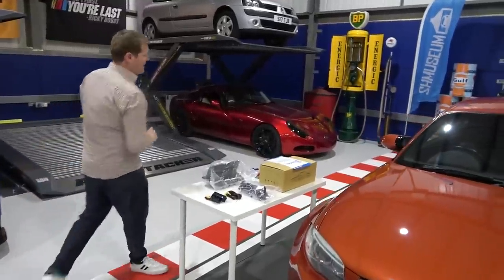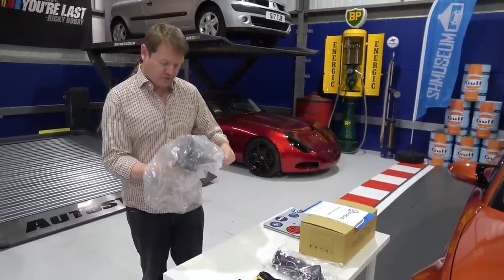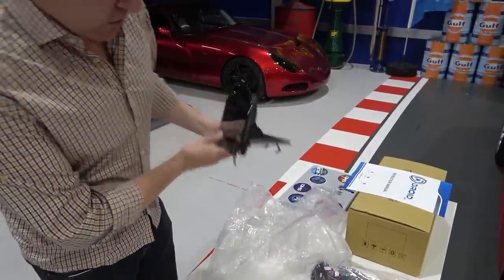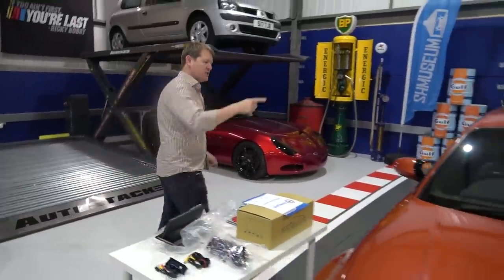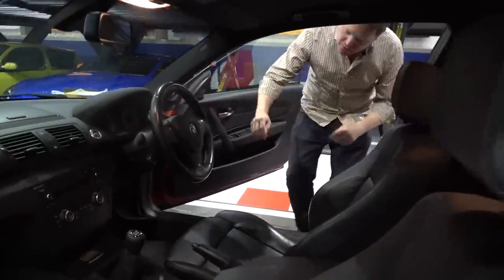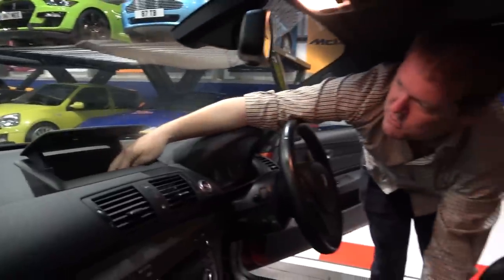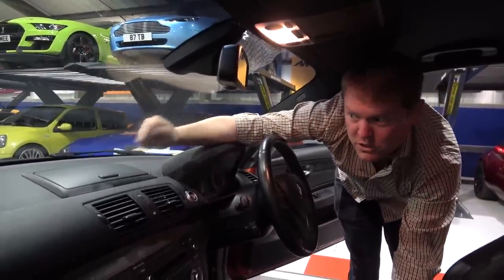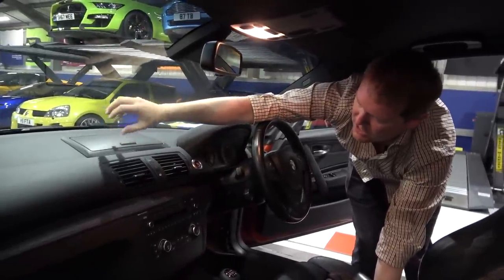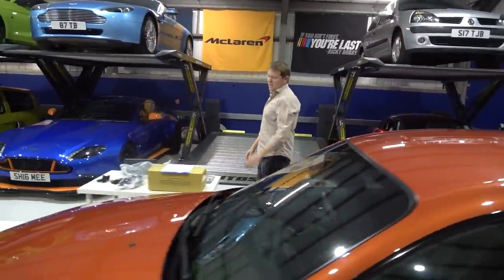But the first of those upgrades we're going to crack on with today — something I've mentioned a few times — which is to fit a new entertainment system with Android Auto and Apple CarPlay to replace the storage bin on the dashboard. So E80 Series, or E82 in the case of this 1 Series, could either have a completely flat dash, this storage bin, a small cubby, or the iDrive system, which by modern standards would be really out of date. I've gone for the screen up on the dash — wireless Android Auto available — and I think it's going to be a pretty welcome upgrade.